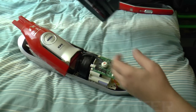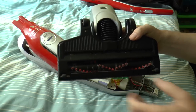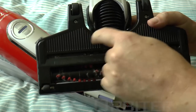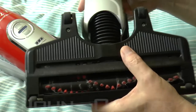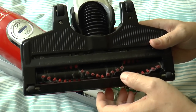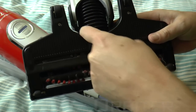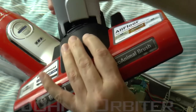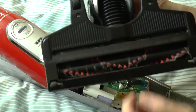The problem initially was that the brush stopped going around at the bottom. I took it all apart and — I'll zoom in a little bit — the motor wiring had sheared off, or been cut, down at the bottom here. That's understandable over time with the amount of flexing that goes on. It's been replaced once before; it's probably just not a very good design. The wire runs down the side to the motor and it's continually flexing.